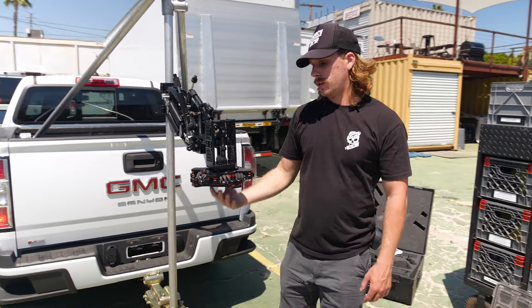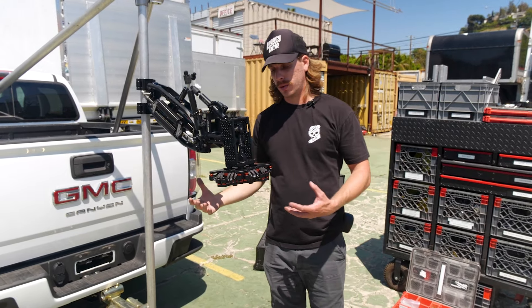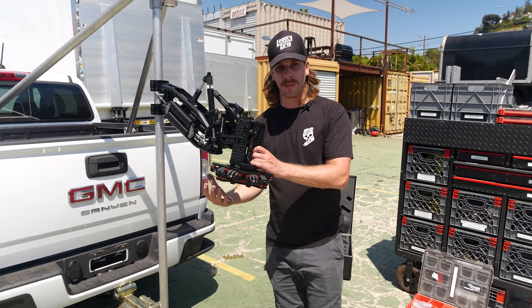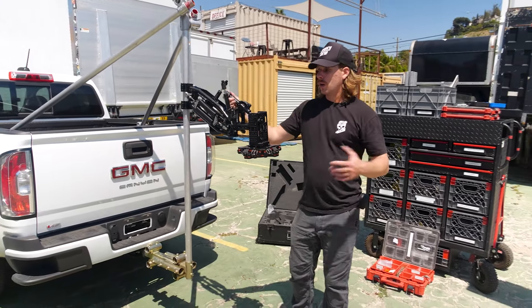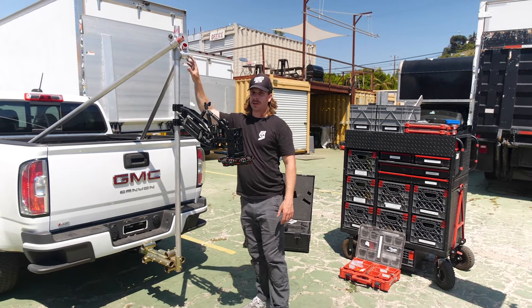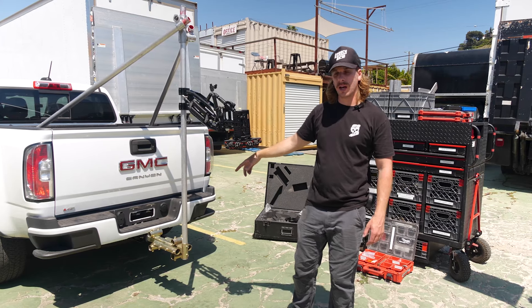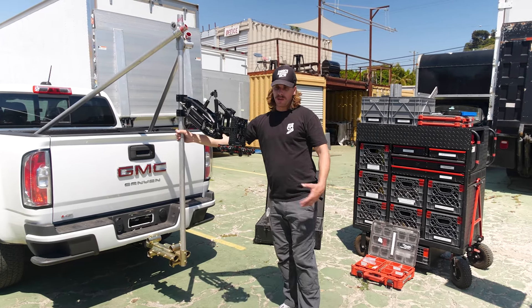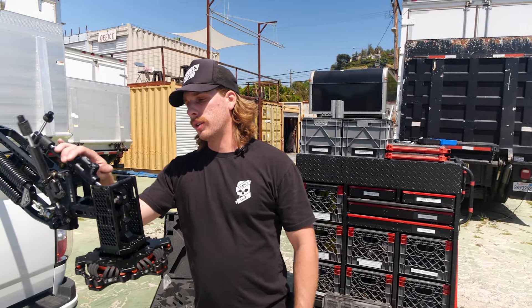For camera safety, once the remote head goes on with the camera, I'd safety the remote head so that if it became loose or fell off, it would just hang off the black arm. Same thing with the camera — make sure it can't fall off. You send this out, everything's safe initially, it comes back — you want to check everything, make sure nothing came loose. I'm checking all the grub nuts, shaking the rig, making sure the unibody pinch clamps are tight and haven't come loose, and checking the trailer hitch. When you're on the road you have micro-vibrations from the pavement and can go over bumps — stuff comes loose. It doesn't mean you've done a bad rig, it just means you need to go over everything again.